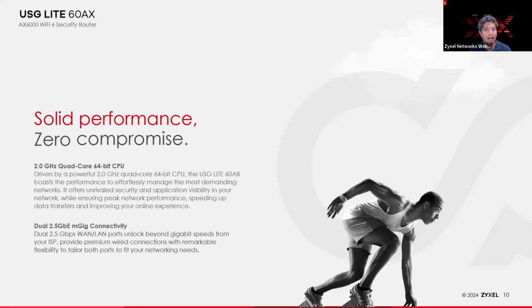If you need more complex scenarios where you're doing many different types of VLAN, port-based VLANs, et cetera, then you might want to think about going to even the USG Flex 100 series, let's say, to get you to that level of functionality. And I'll have a comparison between the USG Lite 60 and the USG Flex 100s in another slide later on, so you can make that decision.